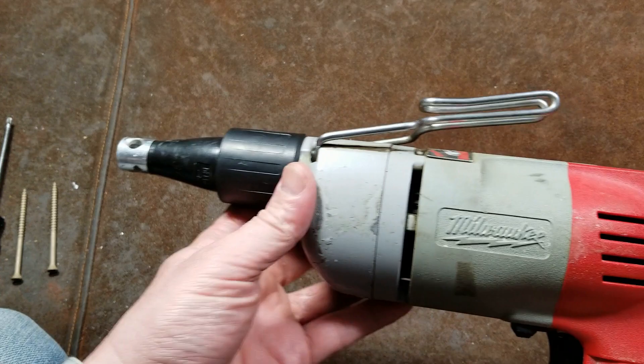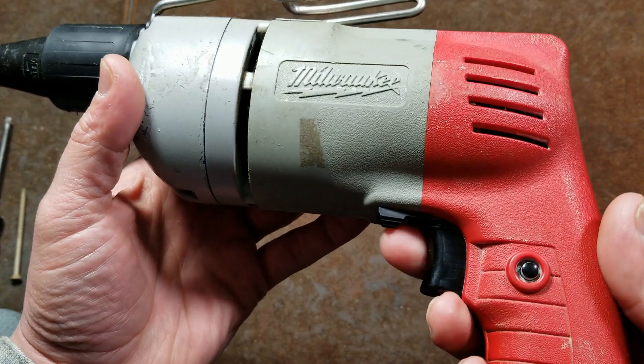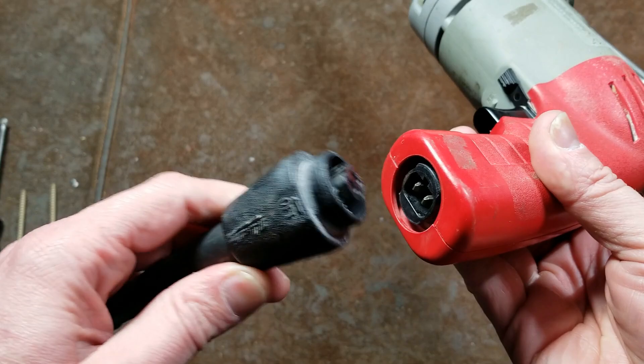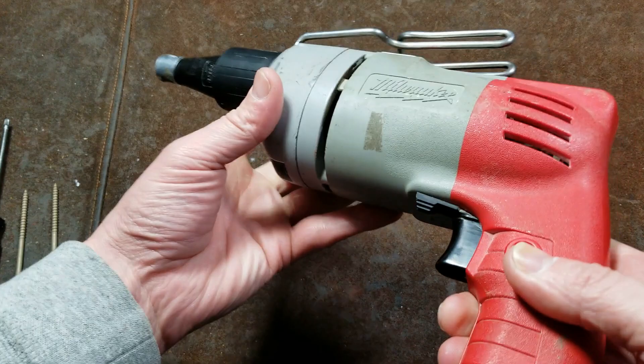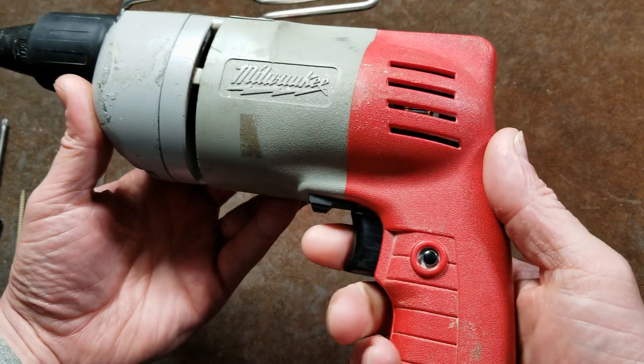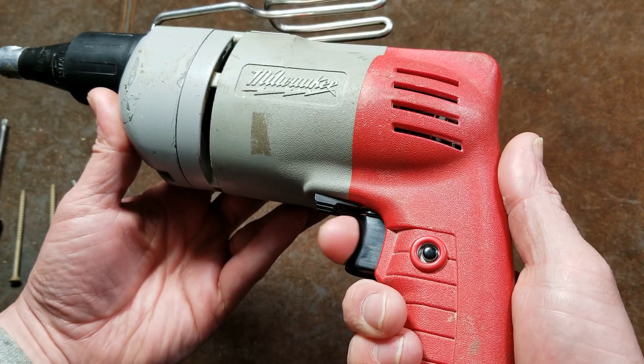Not the best dust mitigation, and that really became apparent with the triggers. This is when they started the idea of having a quick, easy-to-change cord if it got damaged or worn out, which was generally okay except Milwaukee was charging like 30 bucks for these cords. Part of the dust mitigation issue is they didn't improve the trigger, so this trigger here — I can move it quite a bit — and the whole potentiometer in it is totally worn out from drywall dust and doesn't even engage until almost halfway.